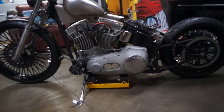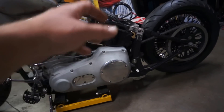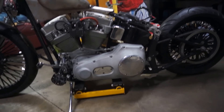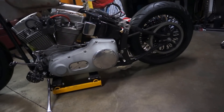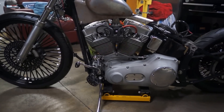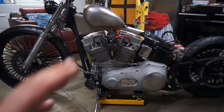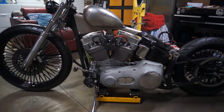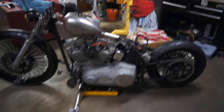I know people have done it, but I don't know that they know exactly what they're doing and if that makes a difference. The rail in the middle of these bikes, because it's a twin cam, is nothing — it has no structural support whatsoever. It's basically there to hold the coil; there's no purpose for that. This is a completely open frame and it being a softail, you get a lot of rigidity from the frame itself and then a separate swing arm. The way these frames are made is probably as least expensive as possible, and that probably has something to do with it. Anyway, that's the reason I do the frame cover — it's not that I particularly love that look, but when it's black and the tank is something a little different, I think it does really blend in and will have a cool look.